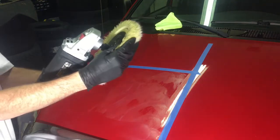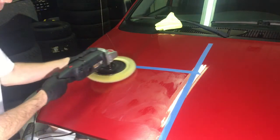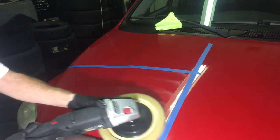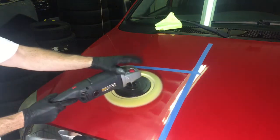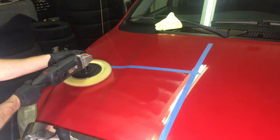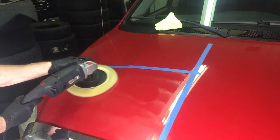The yellow pad is the medium cut or polishing pad. Speed is again locked in at the first setting, which for this tool is 1700, and down-force pressure onto the tool is light. For this step there's a different hand position — most of the grip is on the side of the tool with only the thumb on top. Only the thumb is applying down pressure, which keeps it very light.